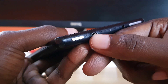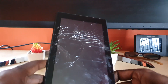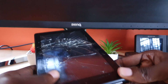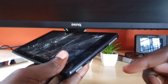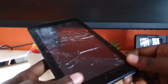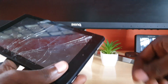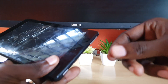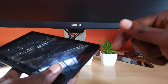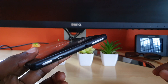If those basic tips fail, check if the port itself is damaged — look to see if any of the mechanisms are broken on the inside. If so, you'd have to get that port replaced. You could also keep the device plugged in; it might be the battery at fault. Keep it plugged in, wait 15 minutes, and turn it on but do not unplug. After a while, once it's up, unplug and see if the battery holds. If the device powers off as soon as you remove the charging cable, it's likely the battery itself and the battery will need to be replaced.